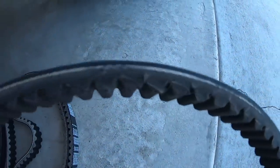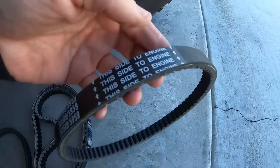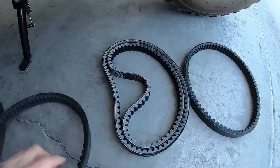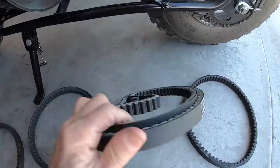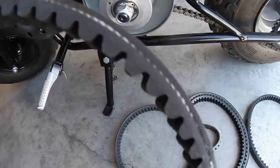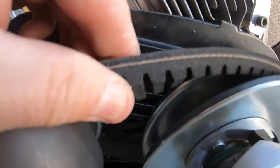After just one ride, you can already see the total wear on that 1PZ belt — it's already fraying and it left residue on the driver and driven, which I've never seen a belt do before. The generic belt looks a little better than the 1PZ after one ride. The Go Power Sports belt, which I've had for months, still looks almost new, and the Comet belt still looks new after that one ride. This is not a sponsored video. For my money, I'm either going to buy the Go Power Sports belt or the Comet belt — it's definitely worth the extra money. Thanks to 504 Minibikes for giving me the video idea.